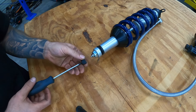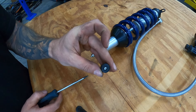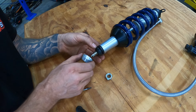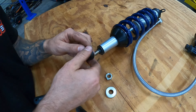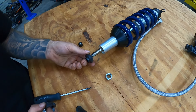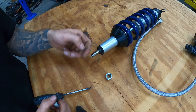With the monoleaf out and our Bilstein struts out, we can go ahead and assemble our RideTech coilovers and get them in. I've assembled one of the front shocks for you guys just to show what it looks like assembled — it's a very simple assembly process. Look at your instructions and you'll see the order of things. Depending on what springs you spec out, you're going to have a different spring rate for the front and the rear, so make sure you get that organized.